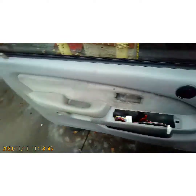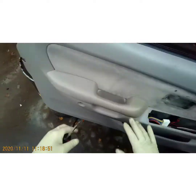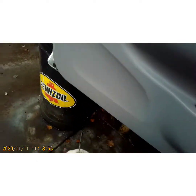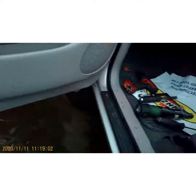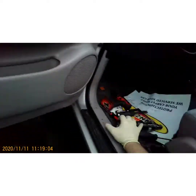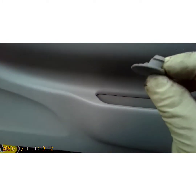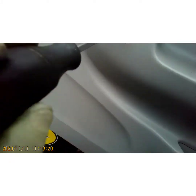That makes the door panel easier to pull up. Now look on the sides, make sure there's no bolts — I don't think there are. Pop out the bottom. There's no bolts there. I'm just going to reach under — you can take a screwdriver to pull out the snap clips. We also have two 10-millimeter bolts here. That little cover is missing on that side. They're Phillips head, not socket head.